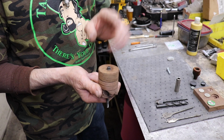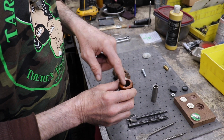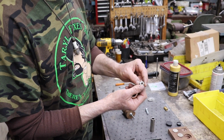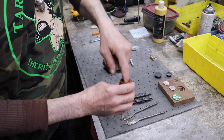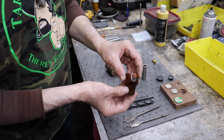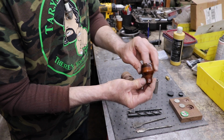So what do I do about the hole in the top? Okay, we'll get to that, hold on. Another thing you can do is core out the center, like I did here for the Spitfire, big enough so that you could get a nut down in there. Or you can buy what's called a slotted nut. It's a round nut like this, but instead of the hex on it, it's just got a slot in it, so you could screw it on. So if you core it out big enough so you could drop the nut down there and get a socket in there, you'll have to find out what size drill bit you could use for that. Then you could slide this onto your shifter shaft and use a nut to hold it on, because some shifters have a nut down here and then a nut on the inside, and that way you can line it up.